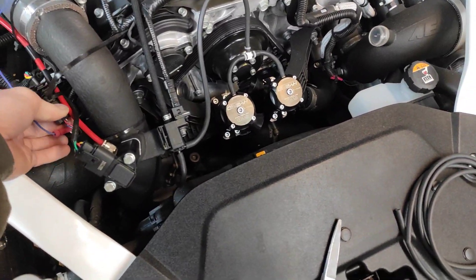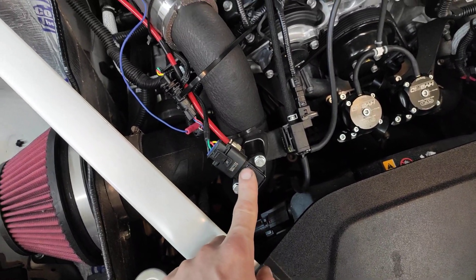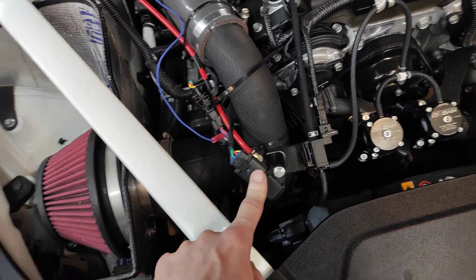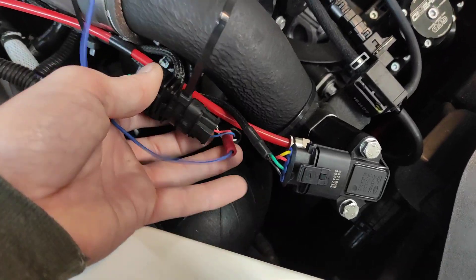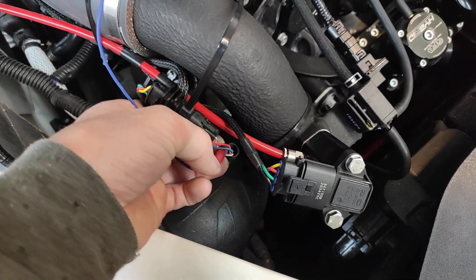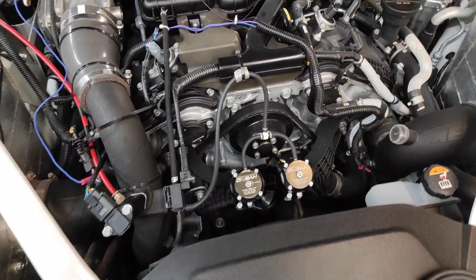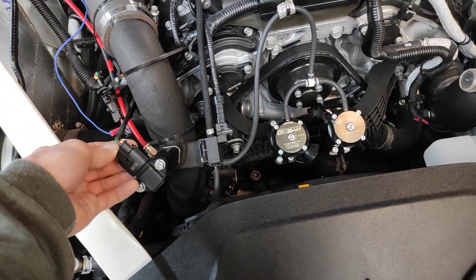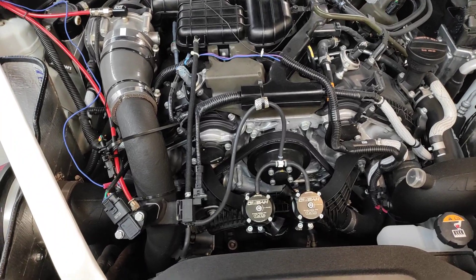If you're running a digital gauge, you would be running off of this sensor here. In this case it's piggybacked between a JB4 and this sensor, so there's actually an extra pigtail — it's a bit of a mess. But there's one wire here, the white one, that you need to posi-tap into. That is a 0.5 to 4.5 volt scaled analog output. So if you were doing digital, you would tie it there, though that's less common.